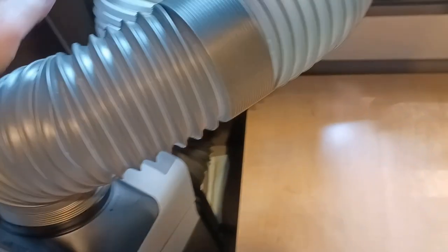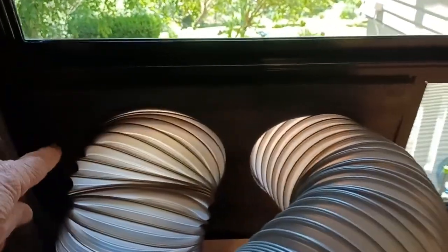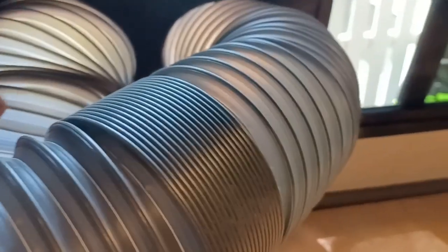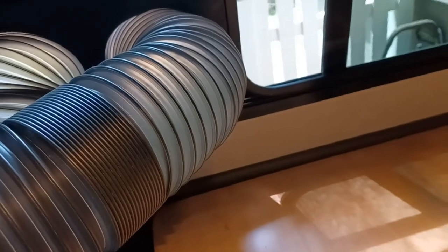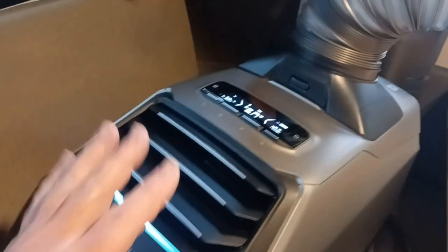Let's review the connections again. The cooled air comes out at the top and you can control the direction with these fins. The intake is in the front. In the back I have this temporary foam template which comes with the unit — I'll probably make a more permanent, stiffer one, but this one fits pretty well except for the corner. It takes in external air with the big pipe on the left and spits out heated exhaust air on the right through the smaller pipe. So the rear unit handles input and output for exhaust, and the front of the unit is what's being air conditioned.